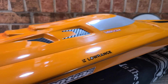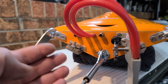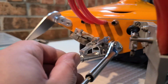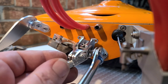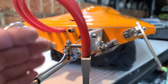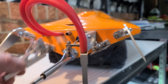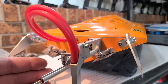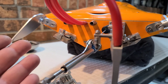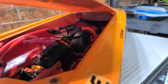Welcome back to the channel. Got the Delta Force 35 on the block — going to be ironcladding this boat out today. I've got a new TFL stinger I've been trying to get on this boat for a while now, finally getting around to it. We've got a TFL stinger on the boat at the moment. This stinger is designed for a catamaran — I think it's for the Cheetah or something — but I like it because it had 110 millimeter length, and I was curious what a long stinger would do on a mono hull. Got it, put it on the boat, it's been great on 4s. Got a TP Power 4060 in this boat.